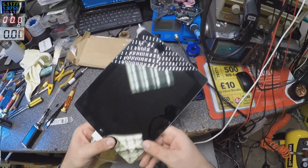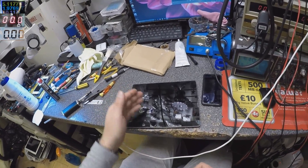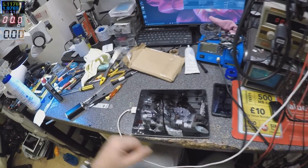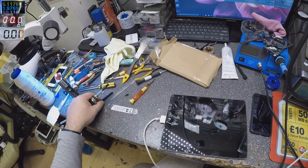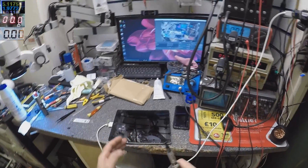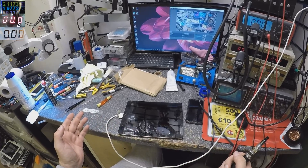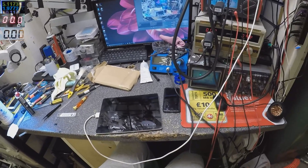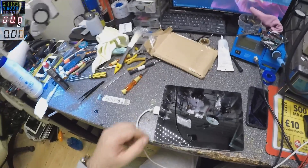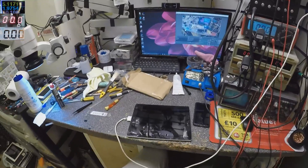I have nothing to fix — I don't understand. They forgot to put the ribbon cable from the charging port back on the board. How is that possible? That's a little bit crazy. So they replaced the battery and didn't charge anything. Anyway, this is more easy for me. I still have the charging sign on the iPad — and it's an iPad 3, by the way.